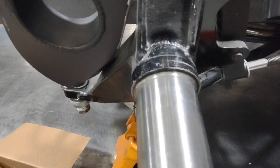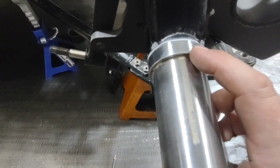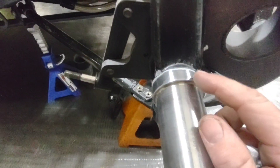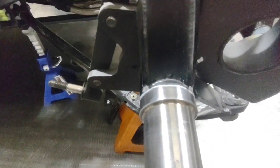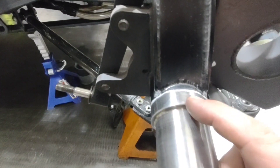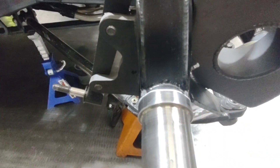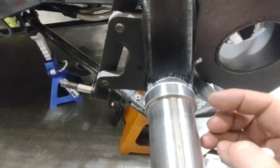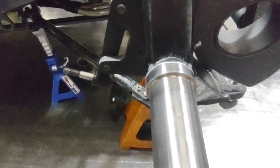So having the bearing spacers on there - if that paint were to flake off and fall out, it would change the adjustment point on those. I'm going to go through and clean all that off. Here is the right front spindle, and as you can see, I've gone through with my emery cloth and cleaned all of that paint and junk off of there. Whoever painted these actually did a great job - they primed them, maybe wet sanded them, great primer with a nice paint finish. But if you have that material on there and it starts to flake off, all of a sudden you've got a gap for oil to seep out.